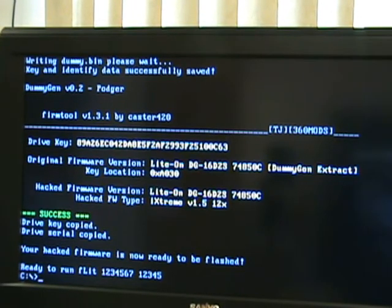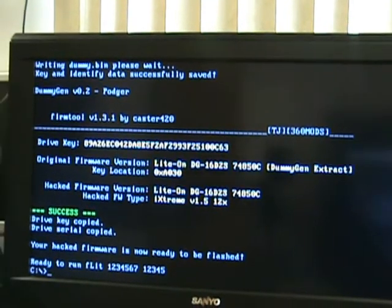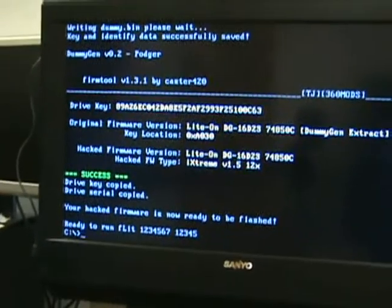Right here, guys, is where you have to power back down, boot into Windows, and make a copy of your entire backups folder. Then power back down, boot up onto your USB flash and continue. If you have any trouble with the erase or with the flash, you've got to have that information to save that drive, to save that console. Jungle had some trouble locking up on the erase with Via. The new stuff works good. You've got to have that for all the drives. You need to save that. I have that information already, so I'm just going to start right here and go straight on to the flash.